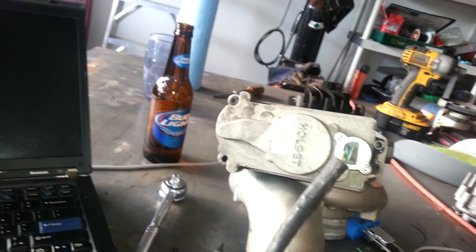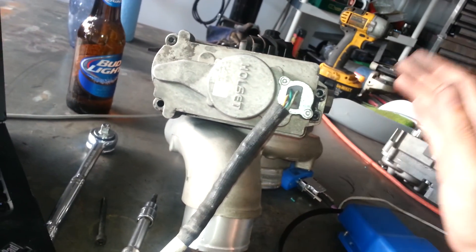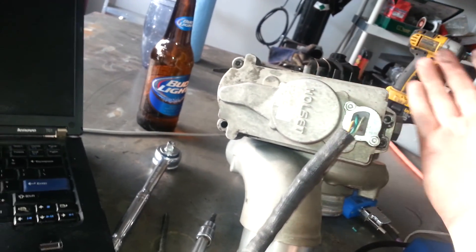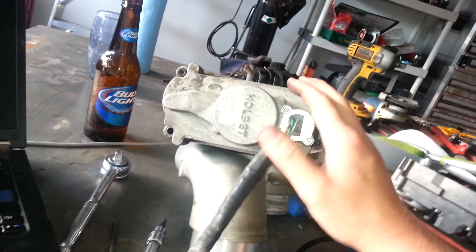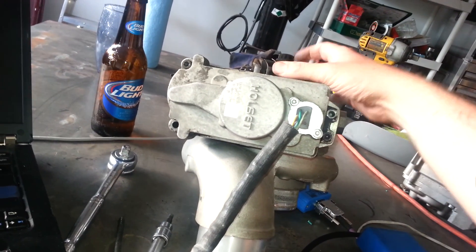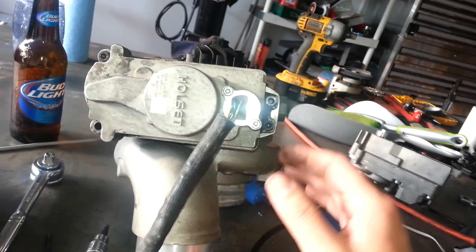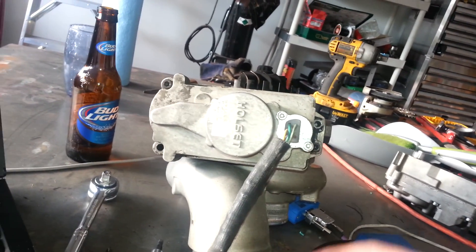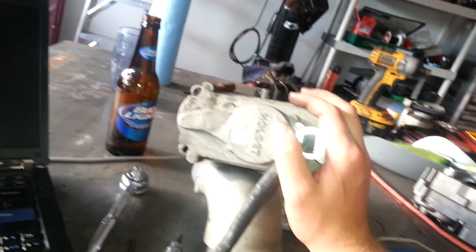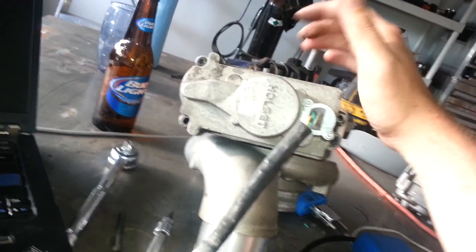I'm still playing with the information from the actuator. There's a total of 8 bits, and it actually gives an engine temperature — well, actually the water temperature that goes through the actuator — and it also gives a feedback on the amount of pressure or resistance being pressed on the actual wall. My plan is, right now I don't have an electric fan, so I'm going to use an aftermarket fan mounted to my radiator. I'm going to use a code from this to activate the digital on-off in my controller, which will then flip a relay to turn on my electric fan based on the information coming from the actuator.